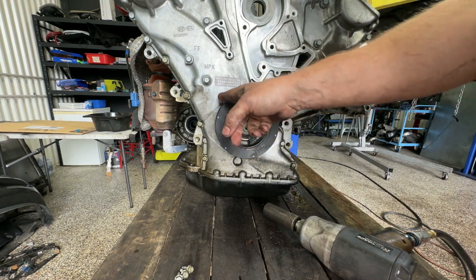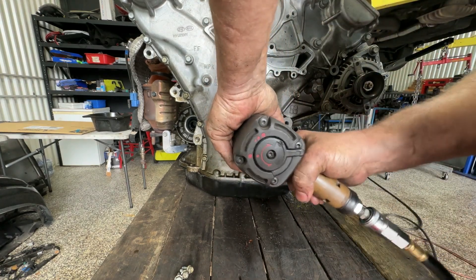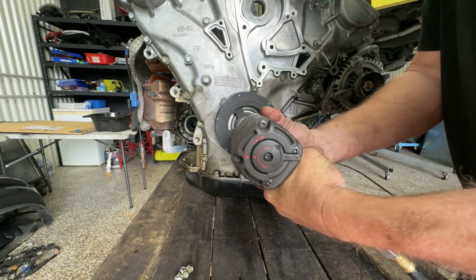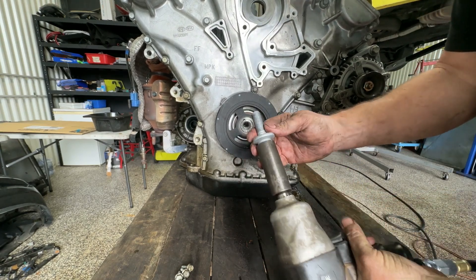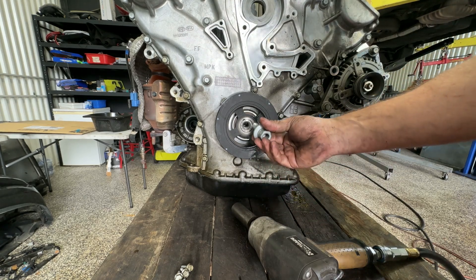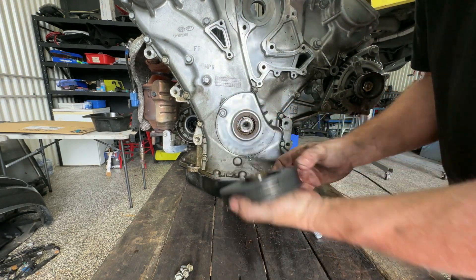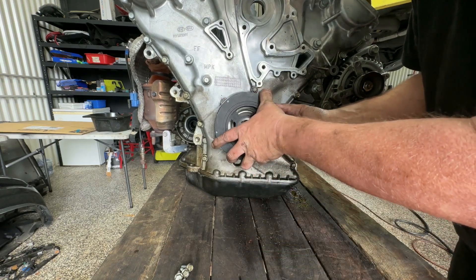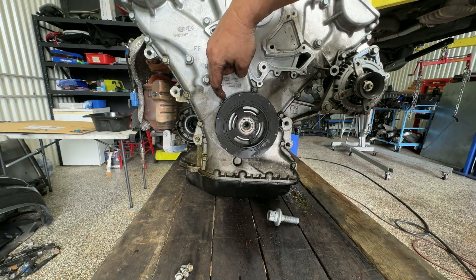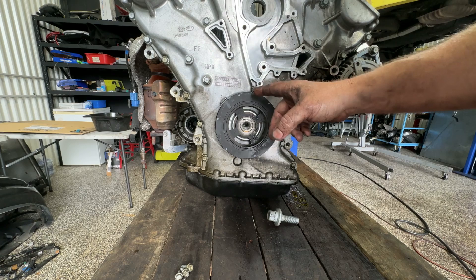Now there is a little timing mark here, so I've got it roughly lined up. I'm not exactly sure where the timing all sits at the moment, but things will move anyway while we undo this crank bolt. That was super tight — I don't normally have to spend that long to break these free. The crank pulley can just slide off. Just double-checking that it's still roughly at the top dead centre mark — yeah, the timing marks are still roughly there. I'm not too stressed because everything's going to be pulled down anyway, but I just want to have a look at the timing marks before I start.